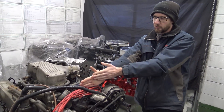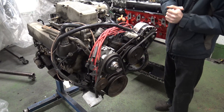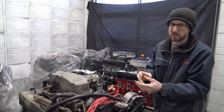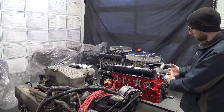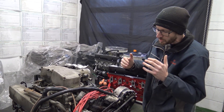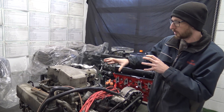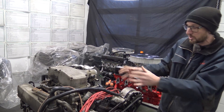Particularly for his part of the world where it's harder to get parts, being able to just use a spanner and a screwdriver on the fuel system is far better. Everything from the exchange engine forward is going to get taken off and cleaned up — new oil pump gears, new water pump. We also need to discuss with the customer whether to paint the water pump and timing cover red to match the block and heads, or go silver for contrast with the black pulleys. We'll also pop the rocker covers and intake manifold off to have a look inside and see its story.